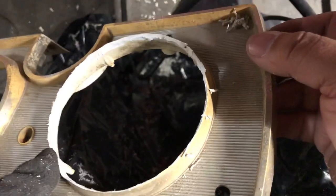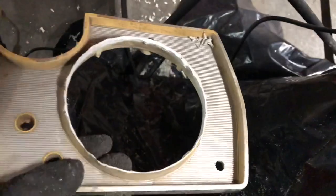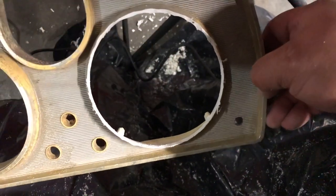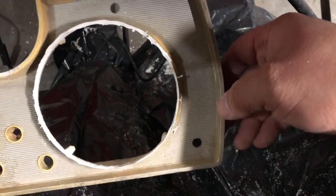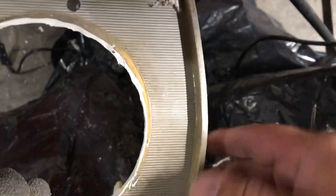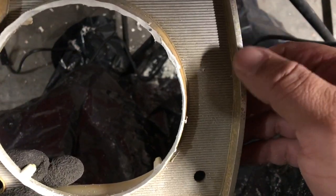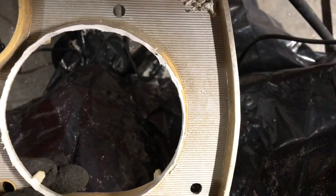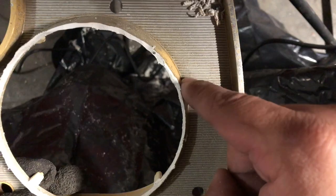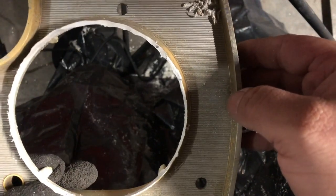That's what I was going for. I'm not finished yet — it's a little rough, I need to clean up the edge — but that inner circle that was in the way is out. Look at the comparison: you can barely tell but that right there makes a huge difference. Now I can actually fit the new gauges in there. Take a steady pace — you don't want to melt the plastic, it becomes a complete nightmare to work with. Follow the line, have a plan of attack, try not to stop and go too much, and let the tool cool as you go because you will start warping it.